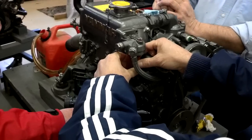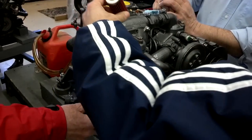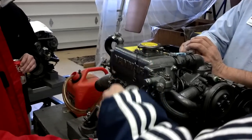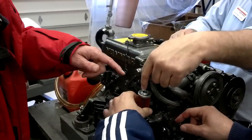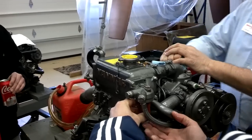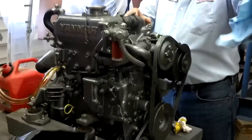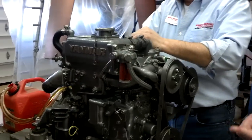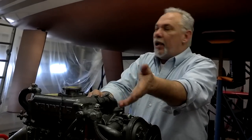Do you unscrew this? Just pull it down. That looks good. It may look good. And the O-ring goes around that little center lip then? Well, there is an O-ring in here — that's going to come with it. The concern's going to be: if you're going to go through the hassle of doing this, you're going to replace that filter. Sometimes if you do get a bad slug of fuel and you've already used up your onboard spare, you may have to use it again.